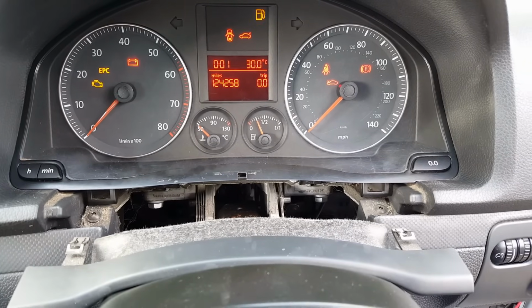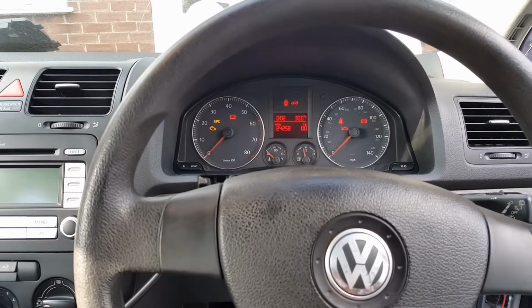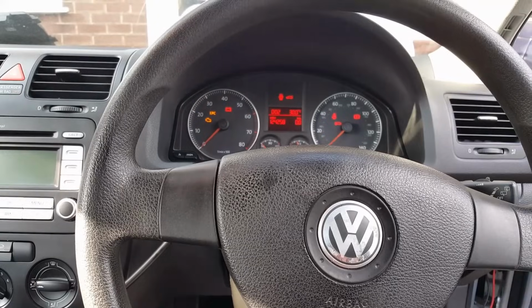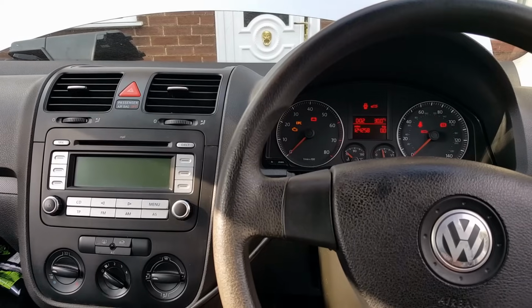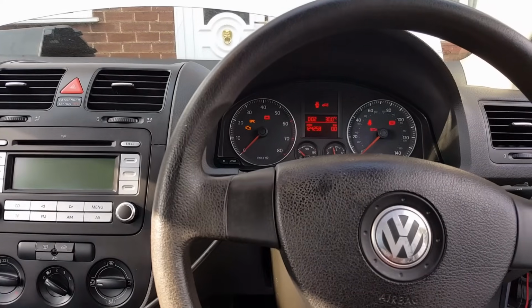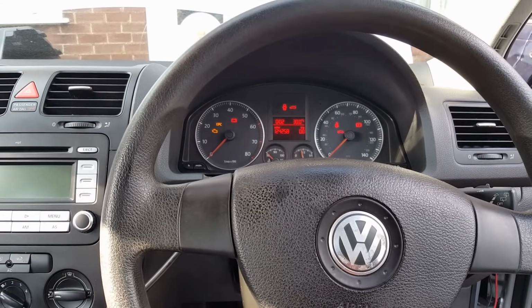Brilliant. All I need to do now is a calibration and that's it. So it seems to be okay, no problem, so I believe that when the fuel sender was replaced, the old one probably was shorted and that was the cause for that fuse on the PCB to burn. So like I said, we put a 0 ohm resistor in there. Guys, it's working. And it took me a few hours to get to this conclusion.